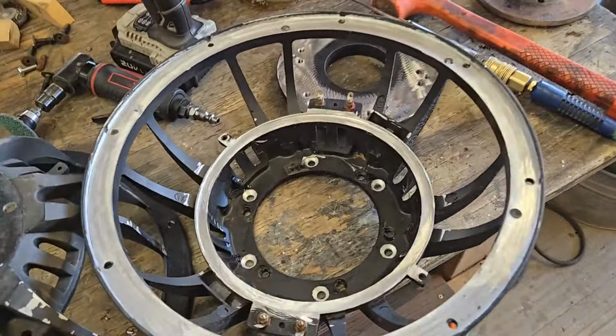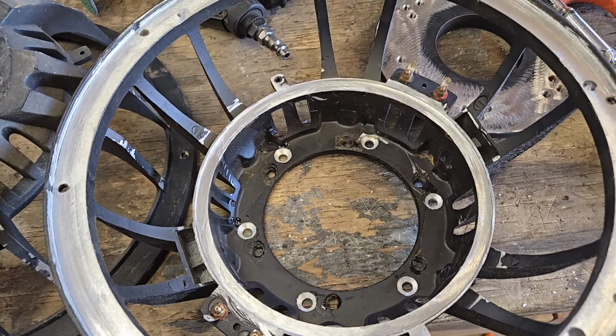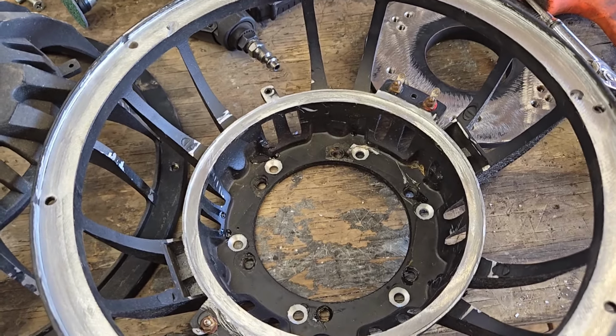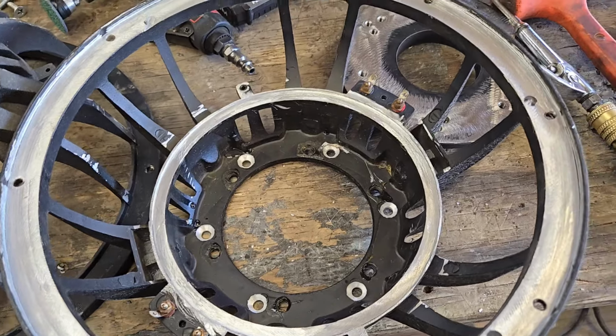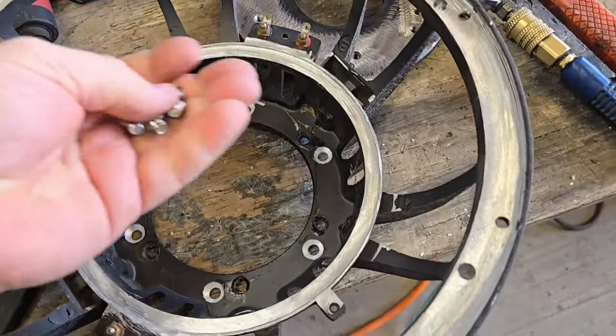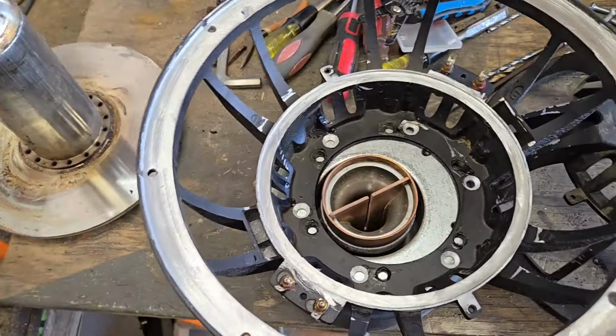So I went back and bored them out to, I think, what is it? Yeah, 1/4 inch, and I think it's something 64ths. That's just slightly smaller than the 1/4 inch that I use. And then I chamfered them, a very crude countersink, so that we can use the flathead hardware. And then let's go ahead and put it on.